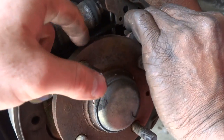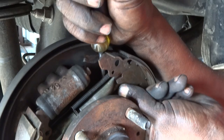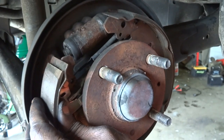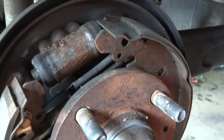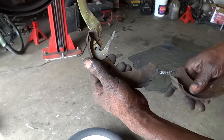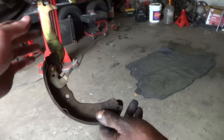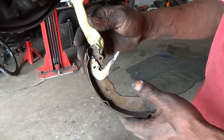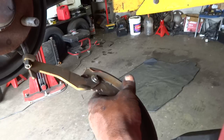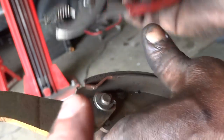You want to pull it away from that little fork right there. Now he's going to take this spring out right here — there's another spring behind it. He's getting some pliers and pushing it forward. Now that the shoes have come apart, he's taking that last spring that was on the bottom, still hanging on to the brake cable. So he's going to disconnect it right here. There's a little C-clip — he's going to get some pliers, put it on one end and pull it until it pushes the clip out.